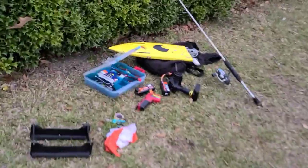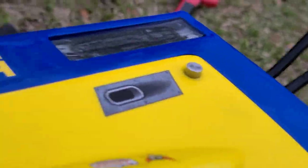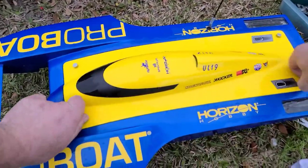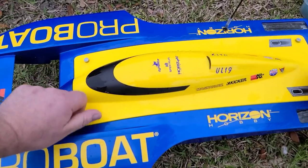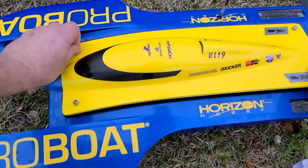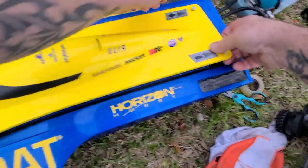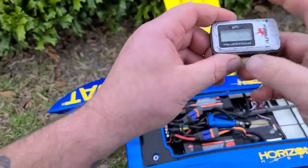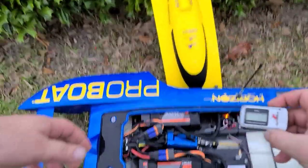That's a battery — either a battery or heat. Let's check it out — see what the temp is. That's a 100C battery, I bet I just burnt my stuff up. I'm sitting here talking about feeling comfortable with the boat and then there's a poof of smoke — just had a power cut. It's either temp or low voltage. I don't see any smoke — that's a good thing. 50 knots and no smoke. 52 miles per hour doing laps.